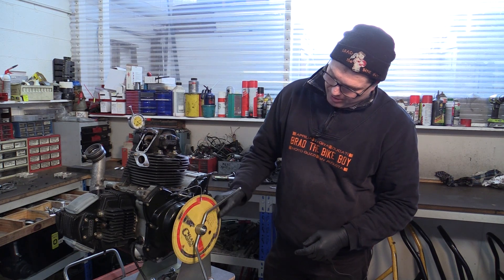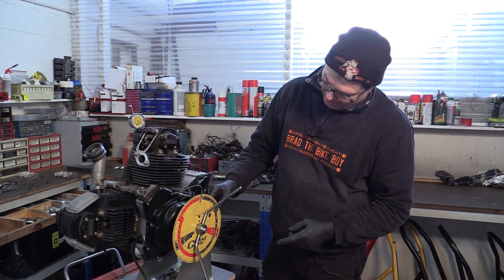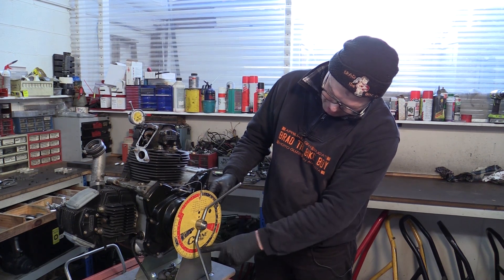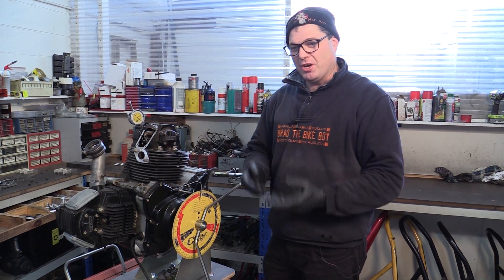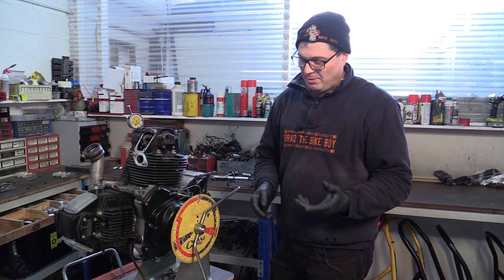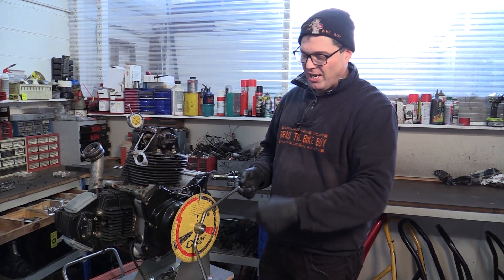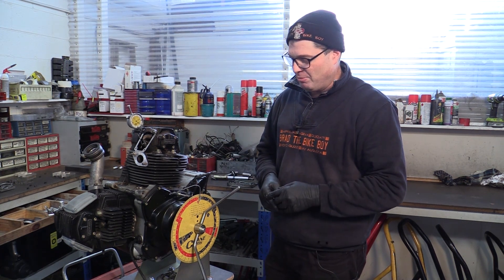The degree wheel is a Crane Cams wheel that I've had for years and years. I like this one because the numbers work in terms of before and after events, so it's pretty easy to find the number you're looking for. When you're doing cam timing, you need to understand what it is that you're looking for. Two rotations of this is one cycle of the camshafts, so you just need to be aware of what you expect to happen when.